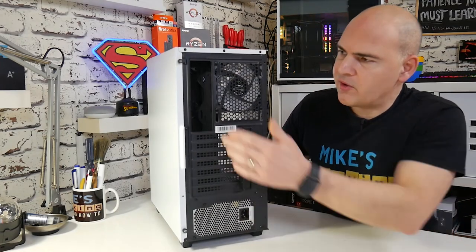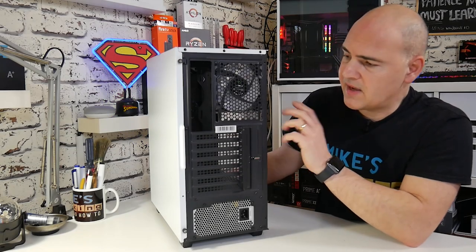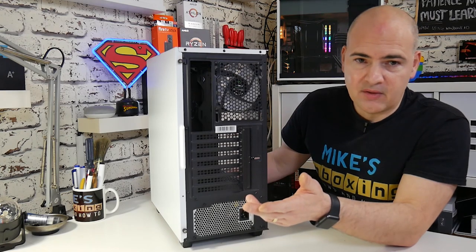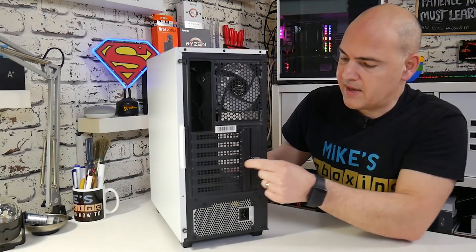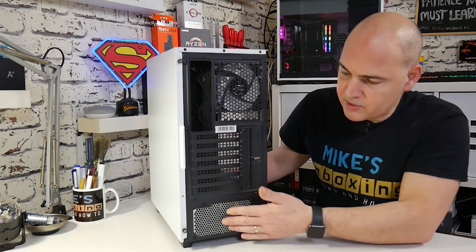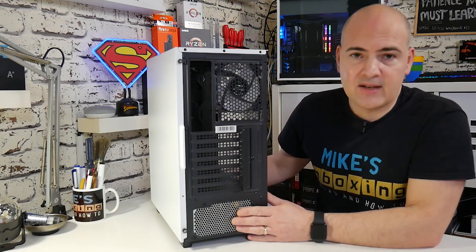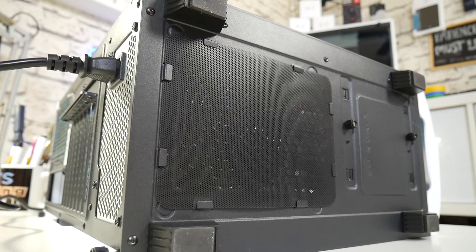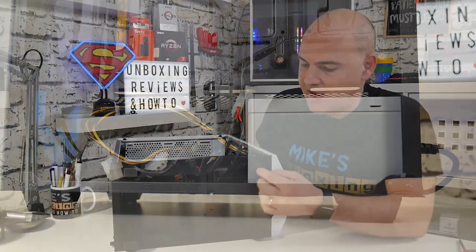Moving around to the rear, it's a pretty standard setup — there's your cutout for your motherboard and a mounting area for a 120mm fan, which is the largest you can go there, with a little room for adjustment up and down. You've got seven slots for PCI Express expansion. These are all captive slots — the ones you have to wiggle out — which is where money has been saved. The back plate adjustment uses a standard screw rather than a thumb screw, again showing where costs have been cut. At the bottom, there's space for up to a 200mm power supply — standard ATX is absolutely fine, or SFX if needed. The case has rubberized feet that raise it about an inch off the ground, allowing some airflow underneath and reducing vibrations. There's also a removable dust filter for the power supply.